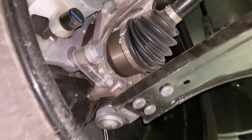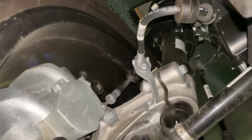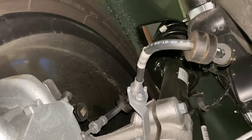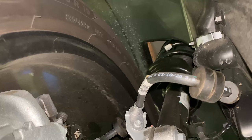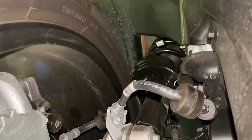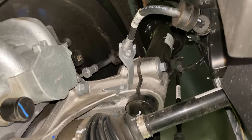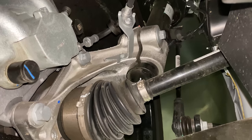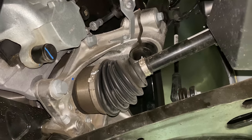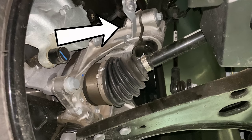Now this has the same sort of shock arrangement, or similar shock arrangement, as what the Mach-E had, but this is a little different in the way they hold the shock absorber. This is something that we recommended for basically cheap cars for a long time, but Volvo's popped it in here. So that's your shock absorber, and it's being clamped in right here with that space in between, which is going to give you the clamp force.